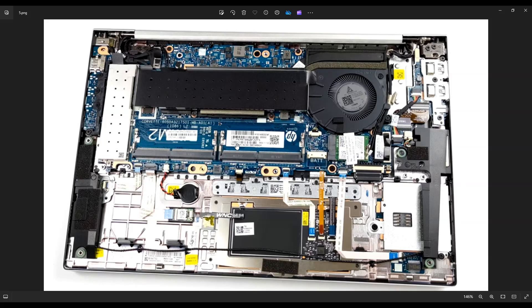To put the RAM stick back in, as you can see here, there's a long port here and a short one there, so you can only put that RAM stick in one way. Get that RAM stick in nice and flush and secure, and then when it's ready, push down right in the center. Those metal spring-loaded arms will snap onto it and secure it in place.